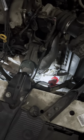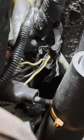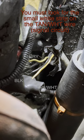I had to make sure I had all the tools to get that oil sensor back on, and it is back on. Now I've got the wires separated — there they are. I'm trying to be as gentle as possible separating them while getting the tape off. I've got to strip them and line them up with the new connector, and just hope that's going to be it. I also used some Goo Gone with paper towels to help weaken the adhesive and clean up the wires — anything that's an anti-grease general cleaner would probably help.